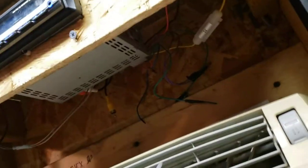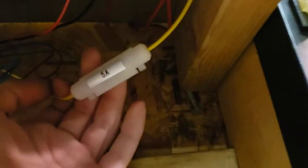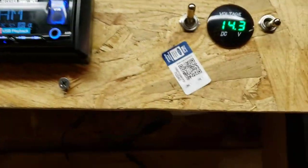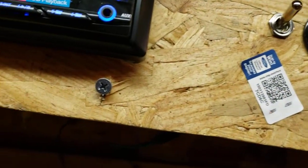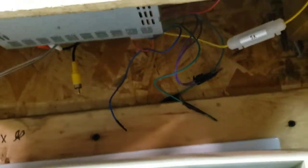It's not ideal, but it works. So obviously your yellow wire is main power, so you've got to keep main power to that in order to hold your clock settings and all that. And then I also have my second switch set up so you can flip it on and that engages your amplifier for the sub. You can obviously just use the blue remote wire that comes pre-installed with the radio — your pre-amp out settings and your aux out for your amplifier.